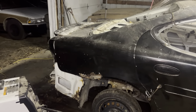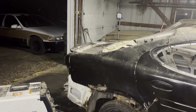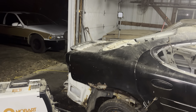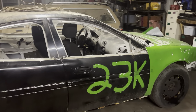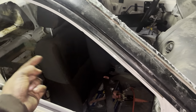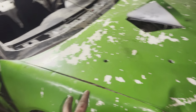There's not much you can do in this class. You can't notch, can't pre-bend. If you remove your deck lid you lose your nine wire, so I just decided there's not much of a deck lid — let's just leave it on. It's just going to make the back stiff which I kind of want. I'll be running my fuel lines around the inside of the seat and then up through there, and I'm just going to do four for the hood and four for the trunk.